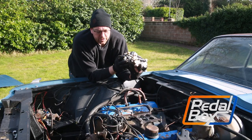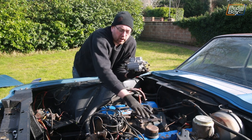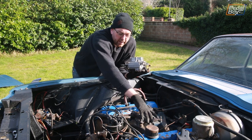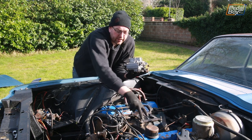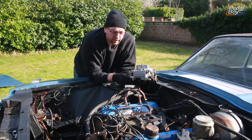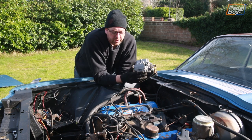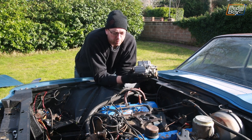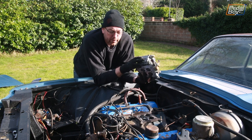With that it's time to install the carb onto the top of the engine. We're going to take this plate off again - we've got the original little phenolic spacer on here - give it another clean down. We taped over so we didn't get any stuff inside it whilst it was laid up, and I also want to clean out the inside of the manifold ports just a little bit more. I can see there's some deposit, possibly from the tape or something. Either way it needs cleaning, then we can put this on.